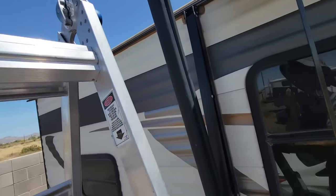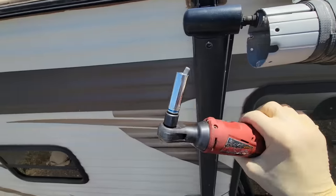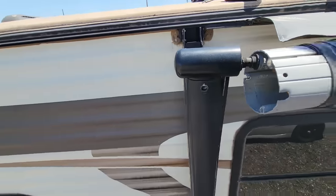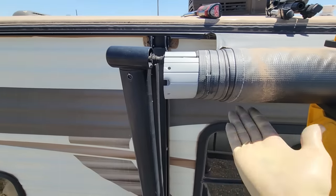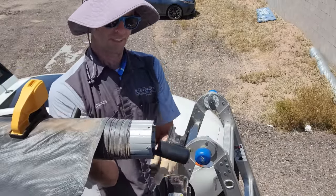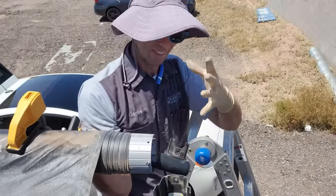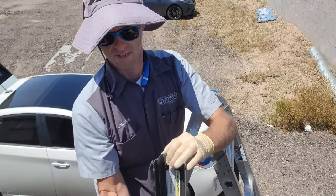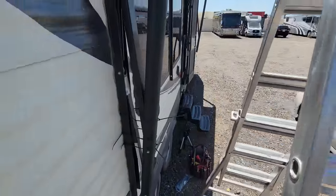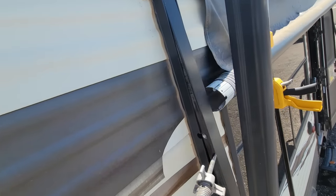So the next step is just going to be to unbolt this torsion right here. Now there is probably still tension on this. That's just a 7/16 inch bolt. So there's still tension on this until I pop this thing up — and then that's an explosive force where you can damage your hand if you have it in the wrong place. All I'm really going to do is lift the whole tube up out of the arm right there. Carefully open that up and because that arm is zip tied in place, it's not going to extend out and hit me. You can see we had tension on there, and if your hand was in the way you would have had some damage from it. Setup is the key to doing this job safely. There's the broken torsion.